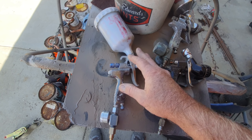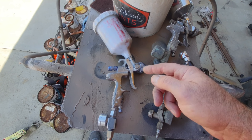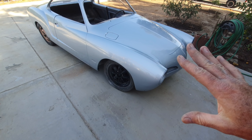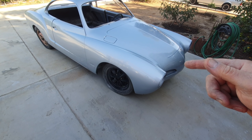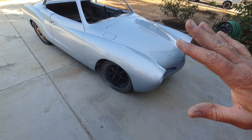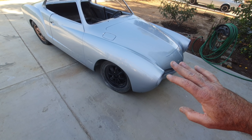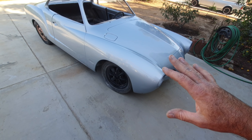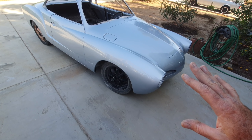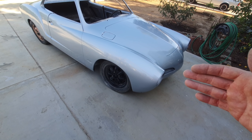Let's take a look at the car. Right now it looks kind of dry and dull, but this is a single stage urethane used as a base coat. What happens is when it dries it shrinks and dies back, leaving a duller finish. All I have to do is color sand it with 2000 grit and buff it out and it'll look like a mirror — very smooth. The gun laid it down with not much orange peel, so it's already smooth; it just looks dull.